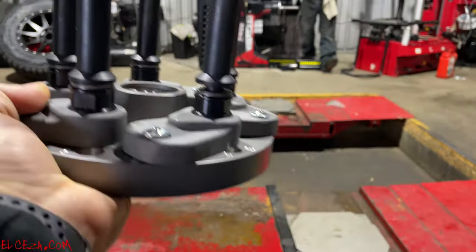In this case, we are going to put a mark on the outside because if you put it on the back side, when it's on this tire changer, you can't see your marks because they're facing down. So just get your little grease pencil and put one little tick that you know you can get off there with the rag. One little tick on the tire, one little tick on the rim. Take it over here, let the air out.